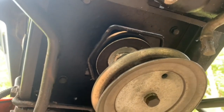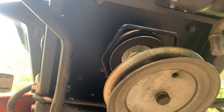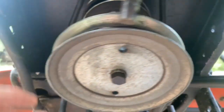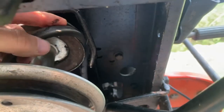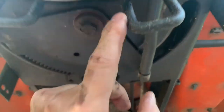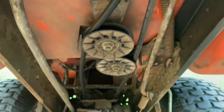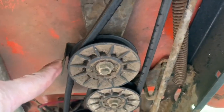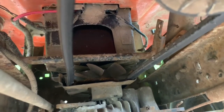Even when I'm not making a YouTube video and I'm just working on something myself, I always take a quick video or photo of how a belt is routed before I take it apart, so you know how it goes back together. The belt slips right off without having to take that bracket off — it just runs right up under here. These can be bent back enough to pull that off. The clutch is disengaged right now causing the belt to have slack, and then it goes right underneath that fan-looking propeller on top of the transmission.